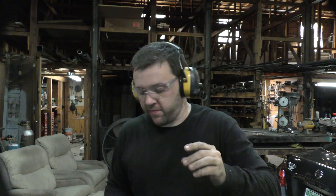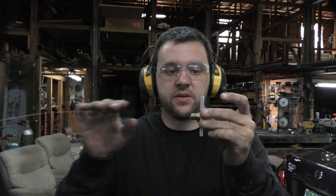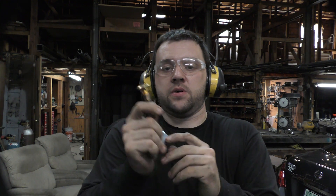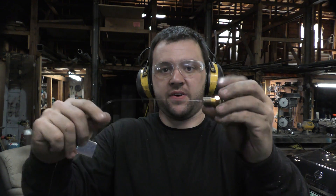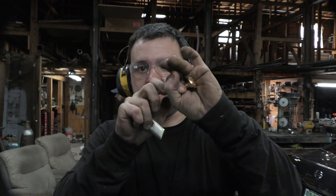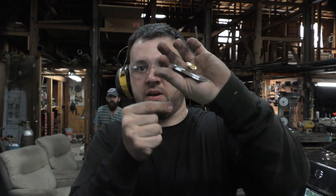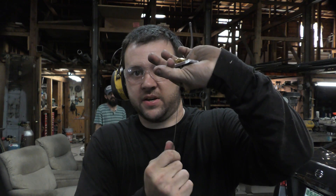This is the back of the vehicle. You're gonna have these carriage bolts and spacers that you need to fish into the frame — that's why we opened the hole up. You'll have to take the bolt on this fishtail wire and kind of feed it through the hole at an angle, then the spacer behind it, and when you pull it all back down it locks into place. Ideally, you can open only the hole at the front of the vehicle and feed the wire into the second hole.